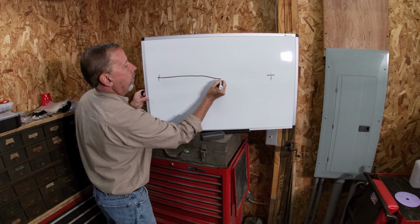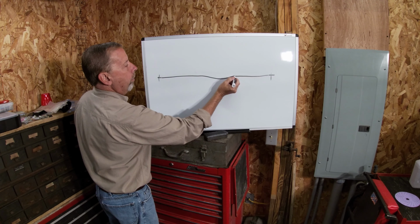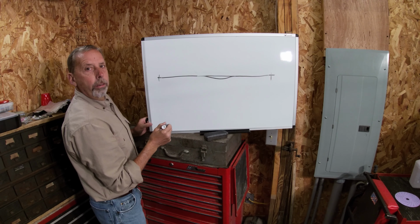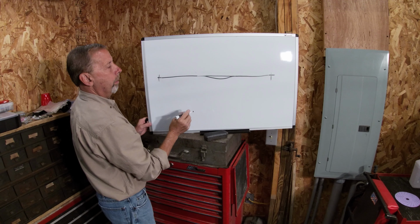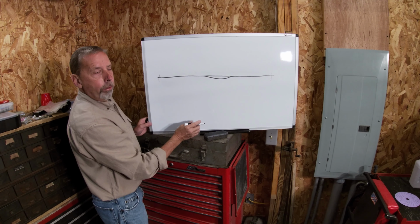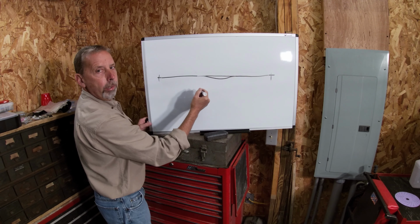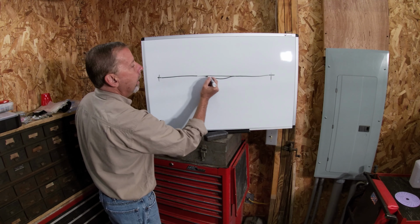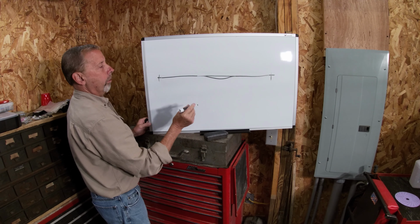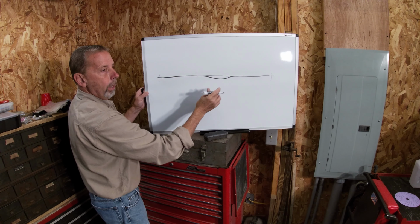Here's our panel, there's our low spot. Come in here and just mix up enough Bondo and fill that in. That's all we're going to worry about. It's just that low spot. Get it taken care of, and let that dry. It doesn't have to dry a long time. We're not worried about doing much feathering, but we're just going to take 80 grit on a DA and cut that down. We're just going to float over it and cut it down. It feels good. It filled most of it in.